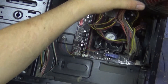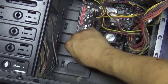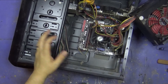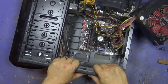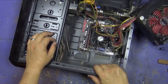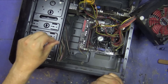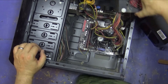Always try, if you've had to unplug something, to plug it back in. I remember once years ago I was sorting out a computer that just kept overheating. The reason they brought it to me was because it was overheating and no matter what I did it would just overheat, overheat, overheat. Then I realised I had unplugged the fan for the CPU. All I needed to do was put some more thermal paste on, plug it back in — job done. But I was so hung up on something making it overheat that it couldn't be me, when obviously unplugging it from the motherboard was me. We live and learn.